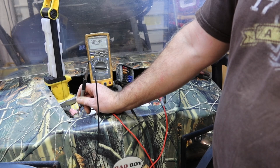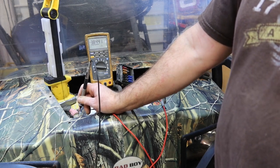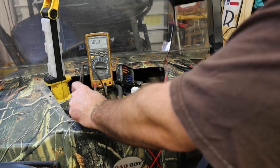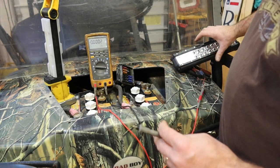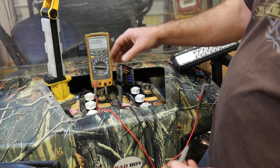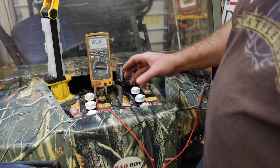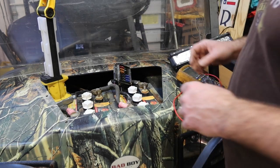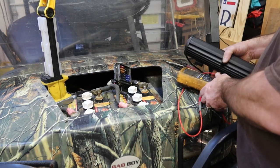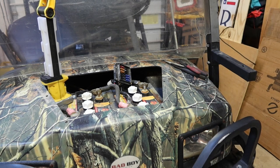And I'm looking at 3.8 amps, something like that. So I've got that much illumination coming through this lamp compared to the two halogen bulbs. That's a huge difference, and I'm only drawing half the current, even less than half the current. So we have figured out that we're going to draw less current utilizing these LEDs than the halogens that came with it, which kind of is a no-brainer. I mean, we kind of assumed that would be the case anyhow.